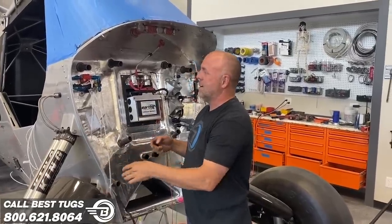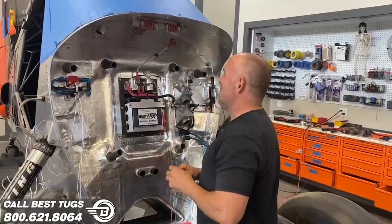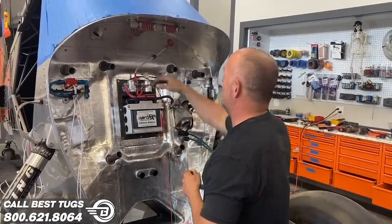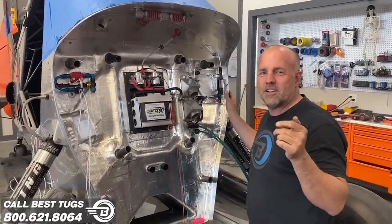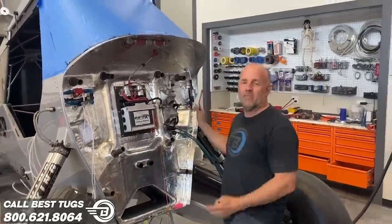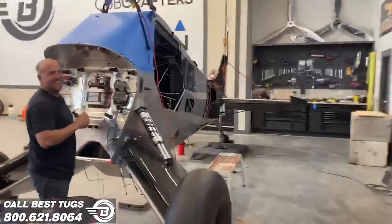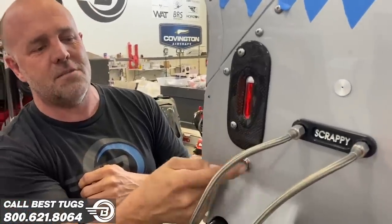I'm just putting ends on everything right now — oil lines, air pressure lines, tying in fuel flow, fuel pressures. I actually have two fuel pressure sensors I'll monitor rather than one — discussion for another part of the build. Got my EarthX in, starter relay, master relay, jump-to-starter relay. The only thing on this whole plane that will always have power is this brake fluid level light — it's wired on its own circuit with its own little mini fuse. It's almost immeasurable the power it takes.